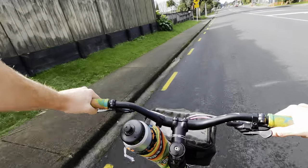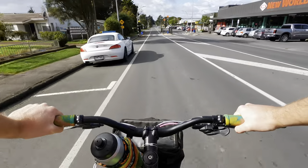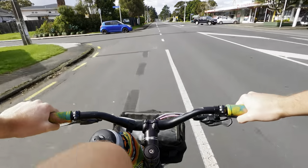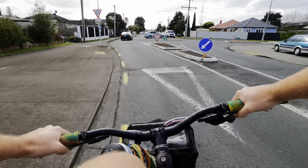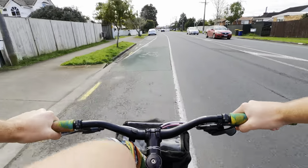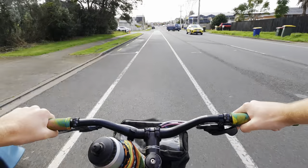Off to test everything now, and I'll be back at the end of the video to tell you what I think of the bike. Immediately I know that the gearing is so much better. The little 33-tooth that was on it before - I could get up to its top speed so quickly and I was spinning out everywhere. I wanted to be a bit faster, but not necessarily as fast as my 26-inch commuter bikes since this is a different kettle of fish. I did get the biggest Profile Imperial I could find at a 46-tooth and it worked out perfect. It's similar to a 36-tooth on a 26-inch wheel if you're familiar.